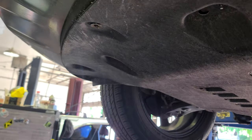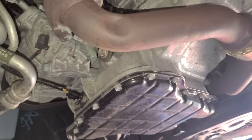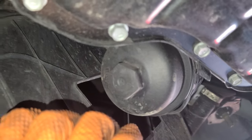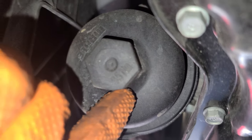I'm gonna leave one bolt in there so it holds the cover while I work. Down here, this is the oil drain plug right here, and right next to it is the oil filter. It tells you how much torque pressure you need when you close it — it's 35 Newton-meters, just so you know for those torque spec freaks.